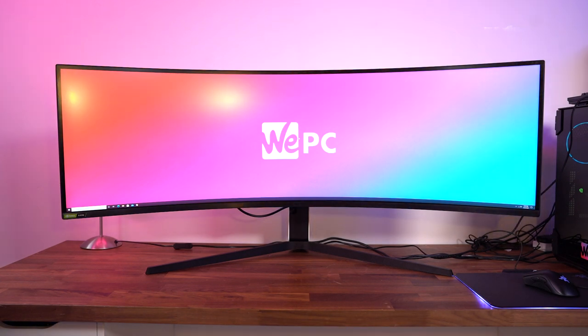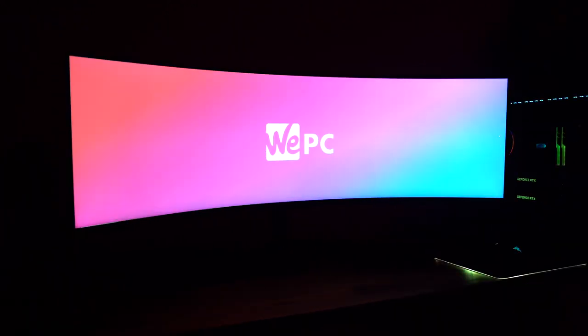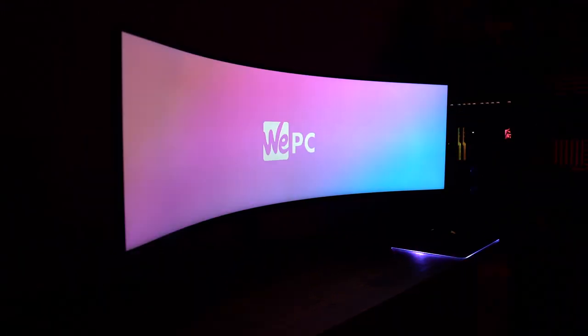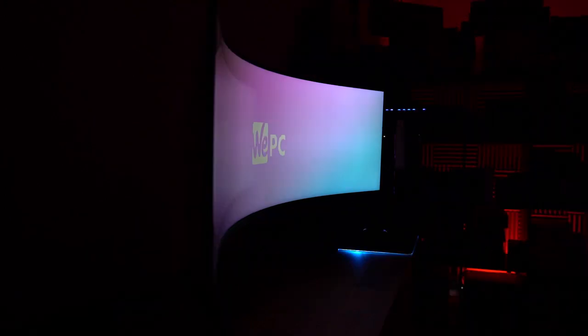Next up, we've got the panel coating. As on most modern monitors, this one uses an anti-glare coating with 3H hardness. It does a really good job of mitigating reflections, any sort of ambient light, sunlight. Because it's curved, it can be a little bit of a pain sometimes, but nine times out of ten, it's pretty much spot on. As far as viewing angles go, I was pretty impressed. VA panels aren't normally the best, but on this specific panel, they were pretty good. They do start to darken after about 40 degrees, but overall, pretty good.